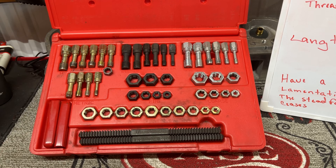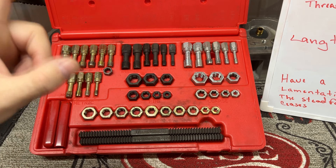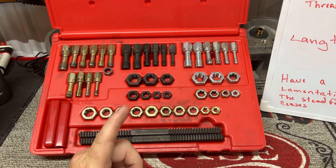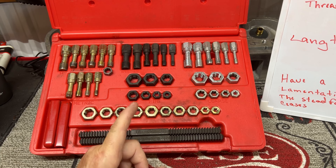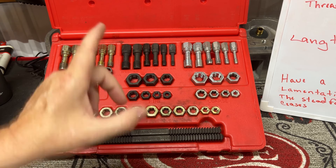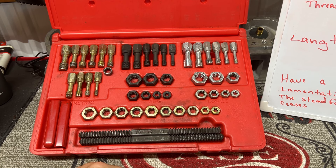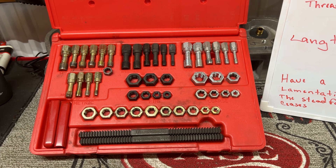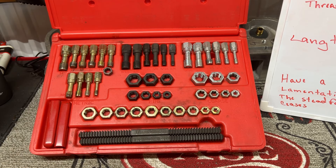This kit has saved me time and money. I use it to chase every single thread and bolt on the last engine I built, and I'm using it on this engine — everything that I'm not putting in new. I used it just last week to chase the threads on a lug on a wheel stud for my stepdaughter's car. I've also used it all kinds of times. My only complaint is I don't have every size I need, but you can see the ones I use the most.